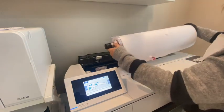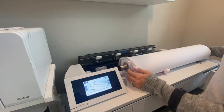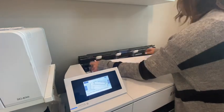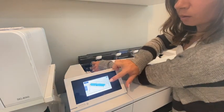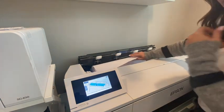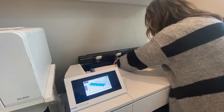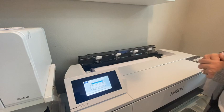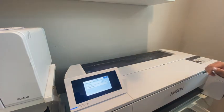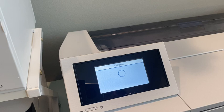You really need a third hand to do this. Set the roll spindle back into the spindle holder — do the right side first. Then insert the edge of the paper into the slot until you hear a beep. Close the roll paper cover and the sheet feeder. It already sensed that I'm using general purpose textile paper, which is what came with the machine. That was super easy, and the on-screen directions are very easy to follow.